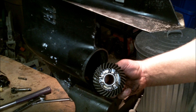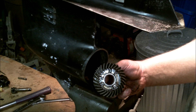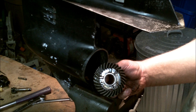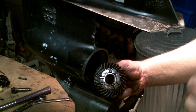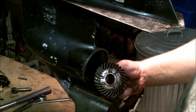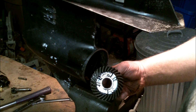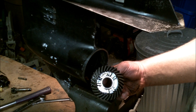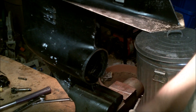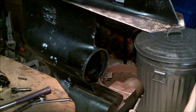What happens is they'll crack, and then as time goes on, at any given second the teeth will just break off. It's usually the teeth break off whenever you're under heavy load, so like if you're cruising along and you mash on it pretty hard — that's when it does it. And that's what this one did, and we caught it before it completely shelled out.